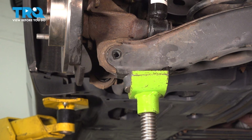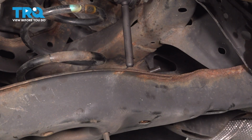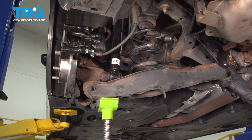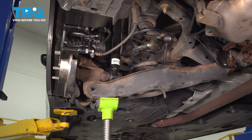We're making our way to the rear sway bar link next. Slide that out of there. Now we're ready to start lowering this down to remove that coil spring. This inboard bolt is the pivot bolt, so this is just going to tip down. Just be extremely careful this does not fall out as you continue on.